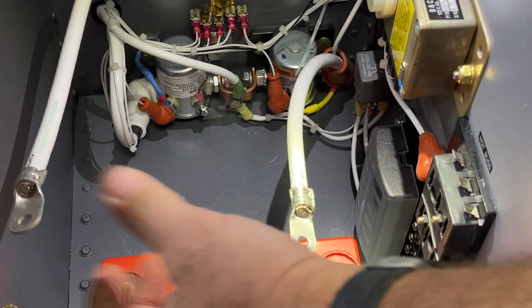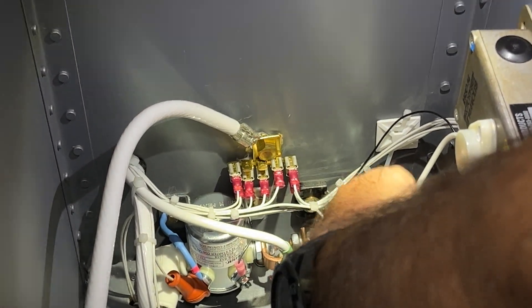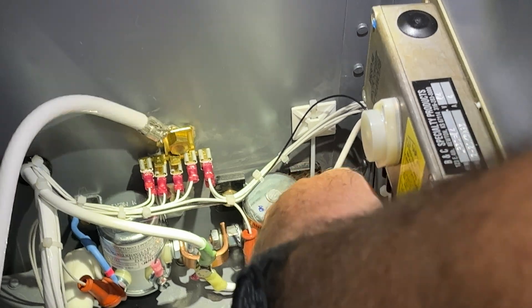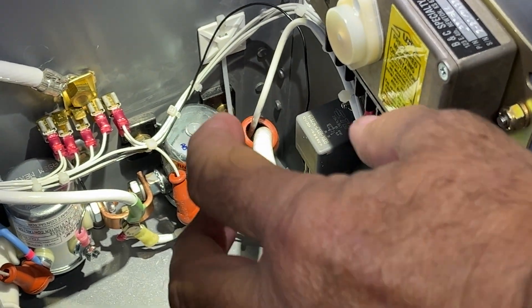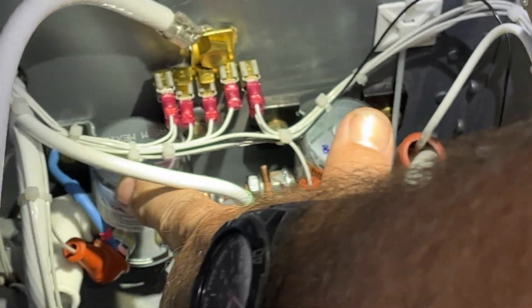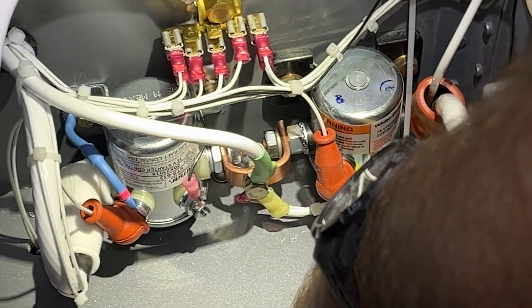You can see the main leads here that go to the battery — I left them disconnected for now. It's very simple to keep in mind: you start with a master solenoid on the right, which is the main power feed controlling power to the whole aircraft, and then connected to that via a nice piece of copper bar is a starter solenoid.